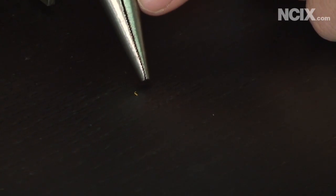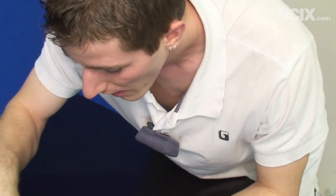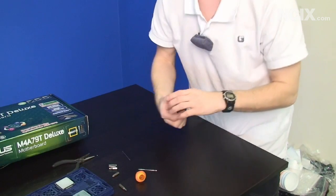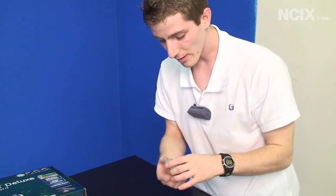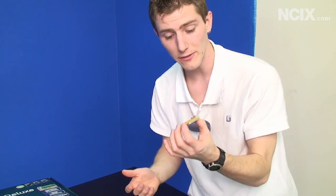You can see that the pin is bent about 90 degrees, but there are actually still things we can try. First of all, we can try the chip in the board and see if it posts, because sometimes you've just knocked off a ground pin or a reserved pin for some future use and there's actually no function to it. So we're going to try that and then we'll be back in a sec.